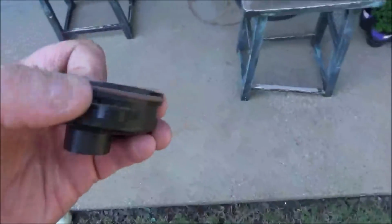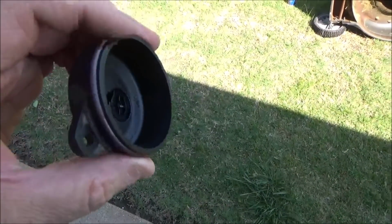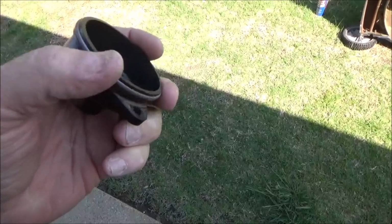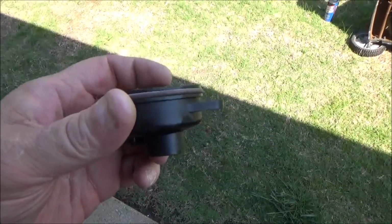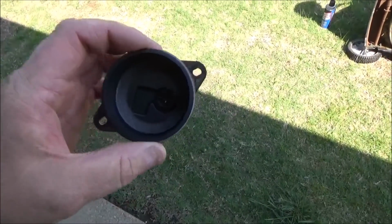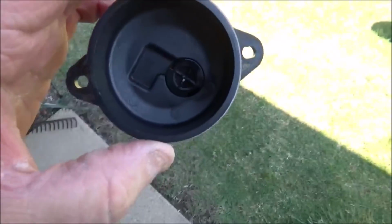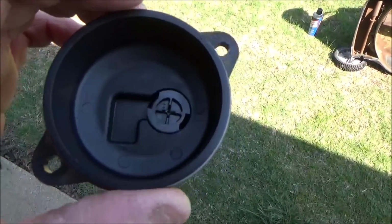And it's got an O-ring around it, which these are a little bit tough to get back on the carburetor whenever you go back with it. So I like to put a little lubricant before you try to shove it back up on there, or otherwise you're going to cut this O-ring. As you can tell, it's not really gummed up at all. Sorry for the wind noise, but I think it's going to work.